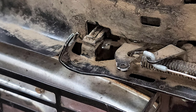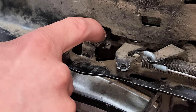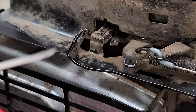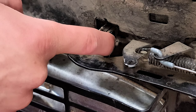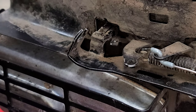The fix is quite simple. All we're going to do is bend that switch stop down to where it's actually making contact on the control bracket. As you can see, if you just push down just a little bit on it, it'll make contact with the control bracket, but we need to push it farther back. So we're going to push back on the lever so we can push the switch stop down more.